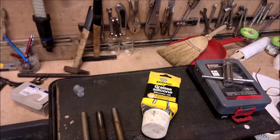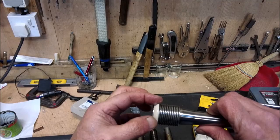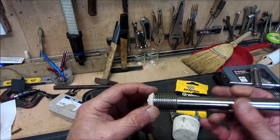So this is the tube prepared. A little bit of silicone grease on the rubber seals. In the Victor Wright's kit, these rubbers are a good quality. I've seen in the cheap kits that these seals, the rubber compound, which is supposed to have a high silicon content, I think, is very flaky and chalky, and I don't get the impression that they would last very long.